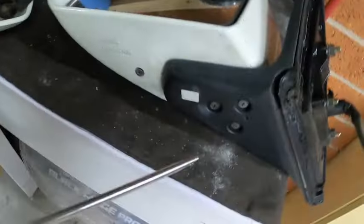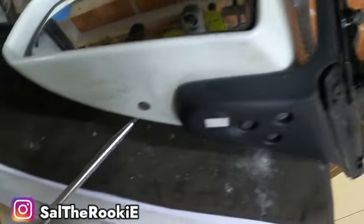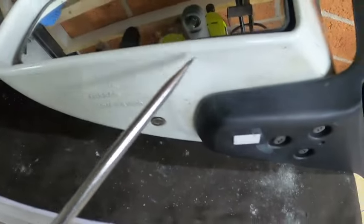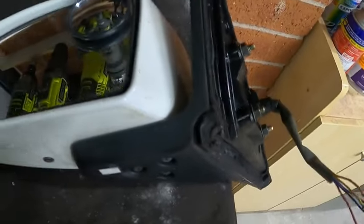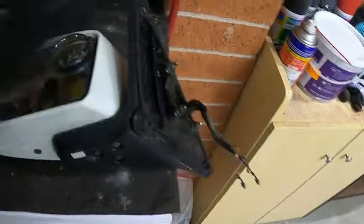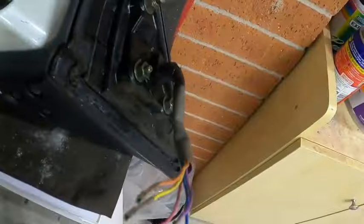Pay attention, this should be fairly easy. This one is already disassembled. You've got three screws over here that hold the bracket to the cover. This screw basically holds the actual motor into this one - mind you there's multiple ones. First order of business: remove those. We've already de-pinned so we can fish the wire through this hole. This is just a rubber grommet.